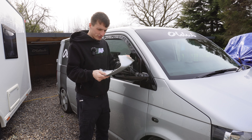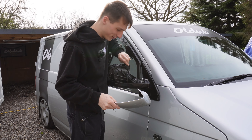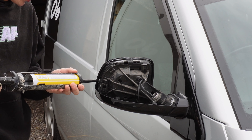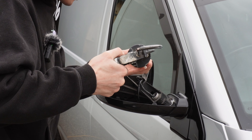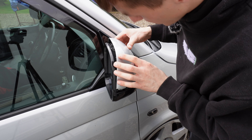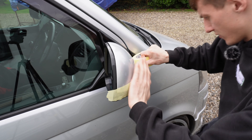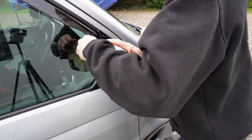This mirror cap has been stuck on — all the clips look like they've been broken previously, and they're just stuck on, so we're going to have to stick it back on ourselves. I've managed to get a mastic gun, so we're going to have a go at sticking this mirror cap back on with Tiger Seal. Tiger Seal is used in lots of body shop applications and this sort of job is perfect for it. The Tiger Seal is going to set off really hard, so we need to make sure the wing mirror is in the perfect position so when it dries, it looks factory fresh. The masking tape just aids us in that process.